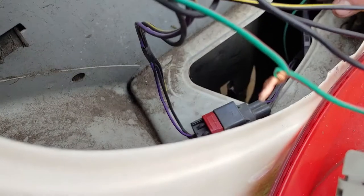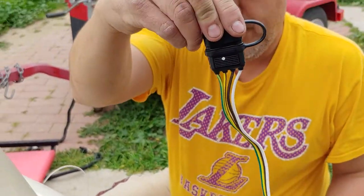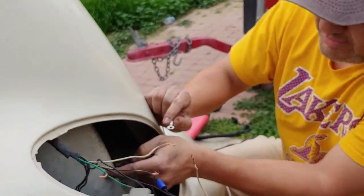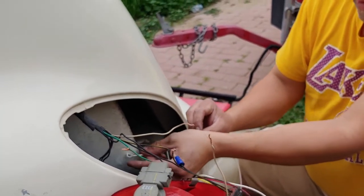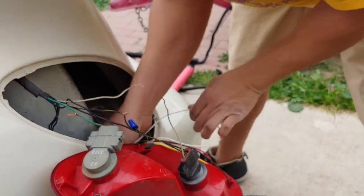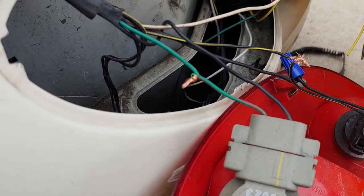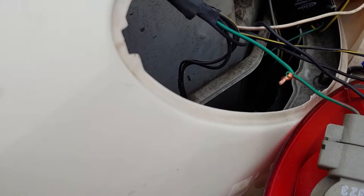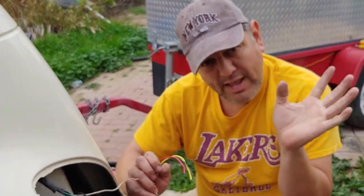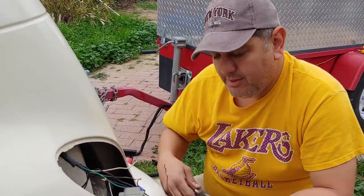So if you notice now, I have my green wire and my actual trailer connector — they're down below the car on this side. I've moved those out of the way. I can scratch and get a good ground and then take this one and get a screw and mount it on the frame. Now, how do I know yellow and green? Because yellow — in terms of left and right — yellow has the L, which is left. Green has the R, which is right. That's an easy way to remember — you'll never forget it. Kind of like righty-tighty, lefty-loosey.